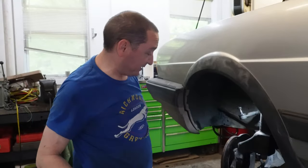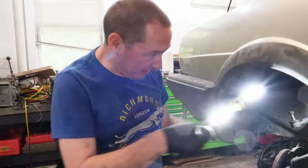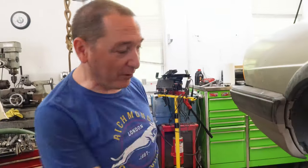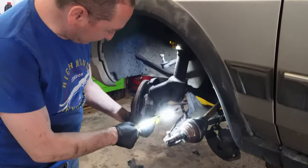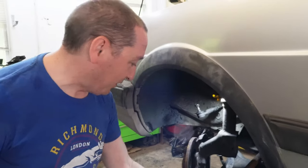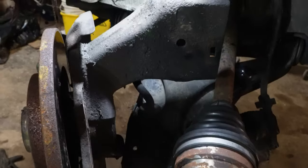A good video to watch on this is Practical Enthusiast, the YouTube channel. The dude has an Audi 5000 that he was doing this rehab on — all of this. This is kind of what I watched to get this out. Had I put this axle in this car without taking this off, that was a struggle bus. Along the lines of the Acura project we just finished, it seems like in these front-wheel drive cars the right answer is always undo the bottom and let it swing away.